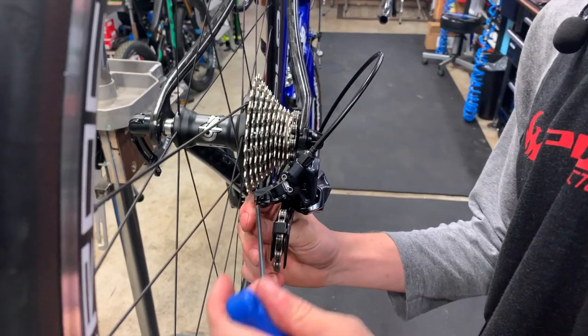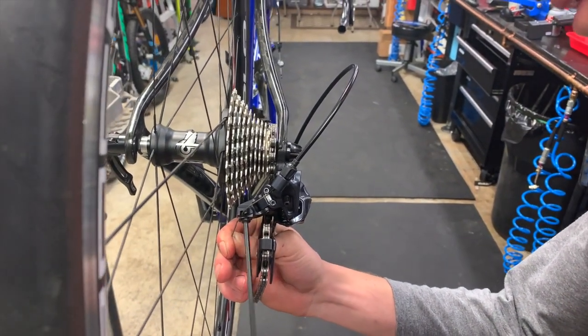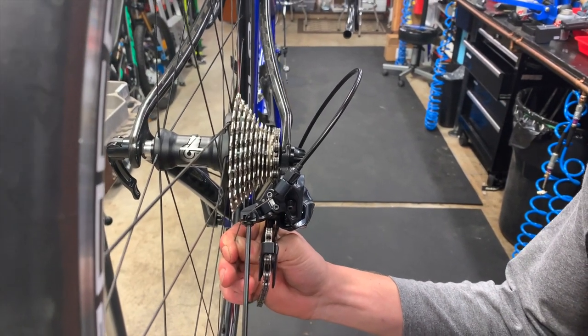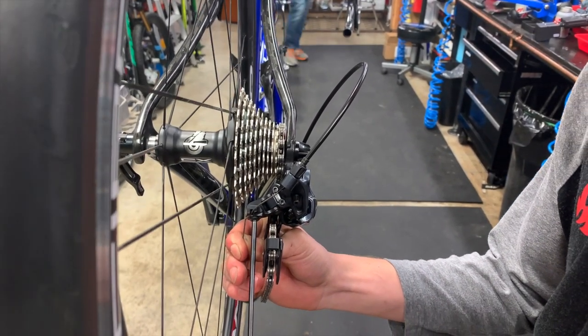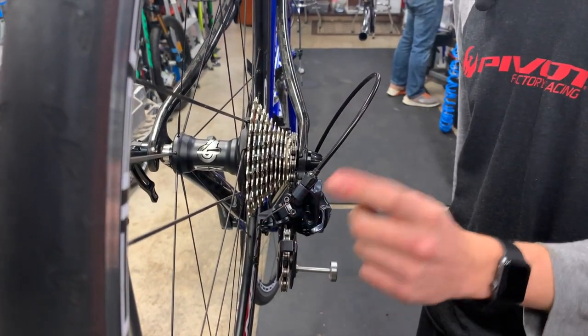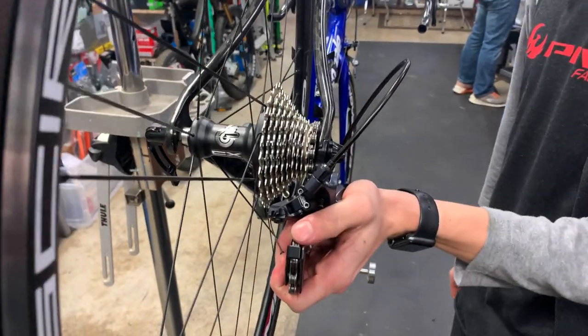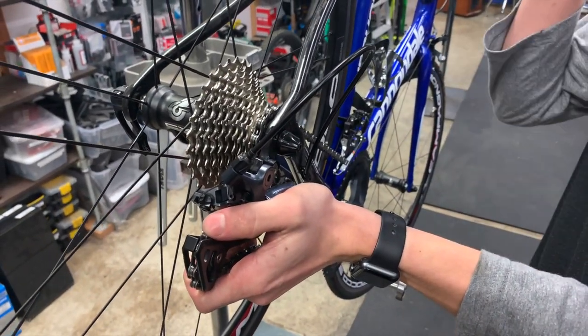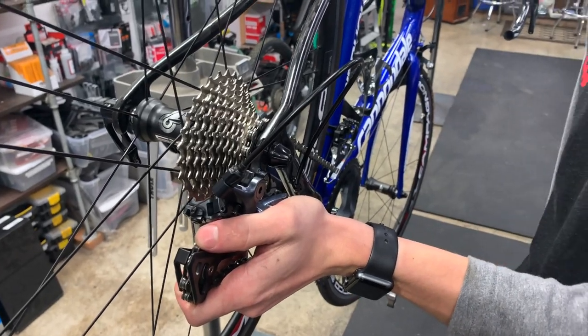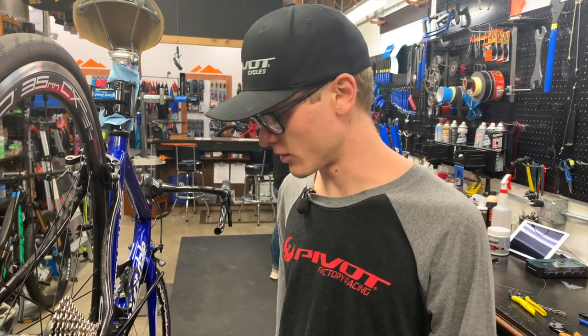And that's the pre-stretch procedure you were just demonstrating on the brakes. Now with the derailleurs, it is very important not to overstretch these. It's pretty easy to slam that shifter all the way through its gears without the derailleur moving — that will either break your cable, housing, or the derailleur itself. It is not the way to do it. Just go ahead and grab here, give it four clicks at a time, no more than that. And sometimes on some derailleurs even that can be excessive. So be really careful not to overstretch.